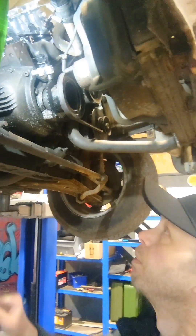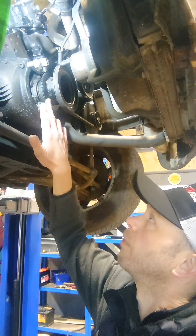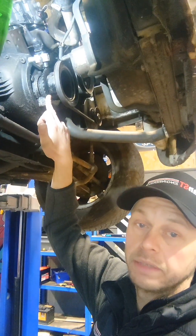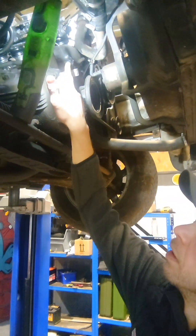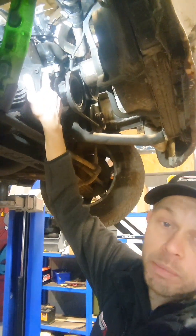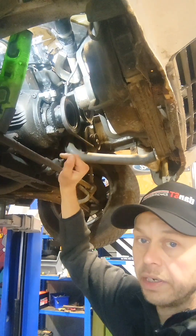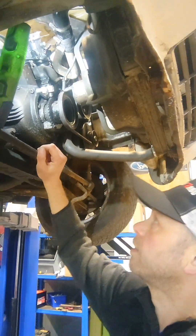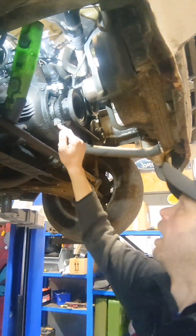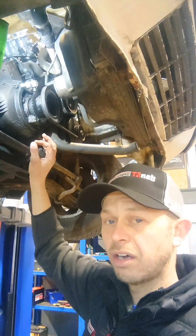The car's up in the air now so we can see the trigger wheel kit. We've got our trigger wheel fitted behind the front pulley, and our crank sensor — which is a Ford ZTEC typical 2-pin VR sensor — on our bracket setup, bolted straight onto this engine. No drilling and fabrication required. We've got just under a millimetre gap between the sensor and the wheel.